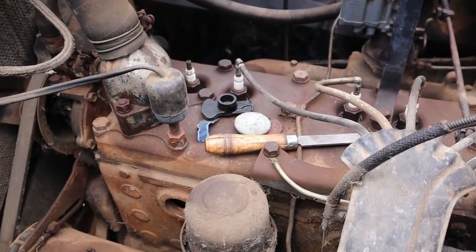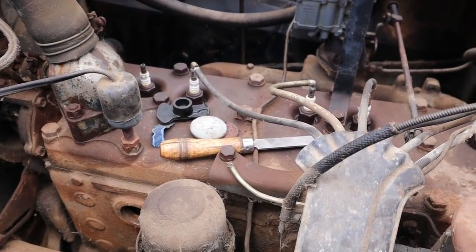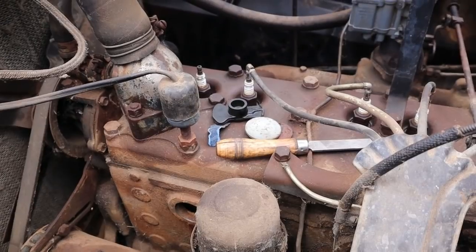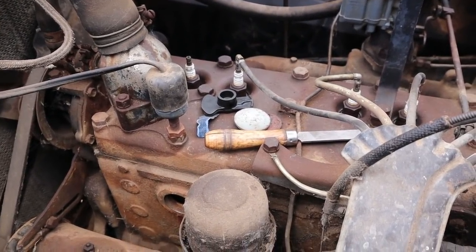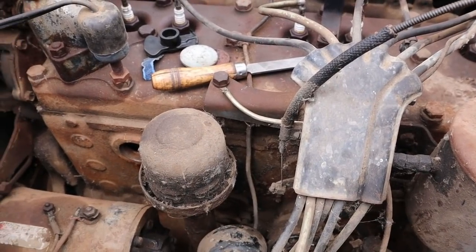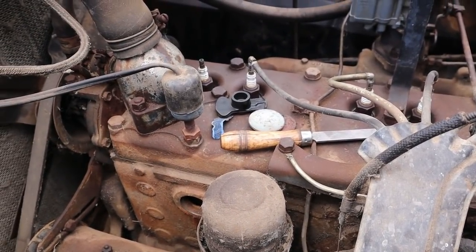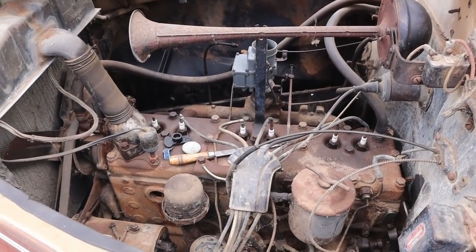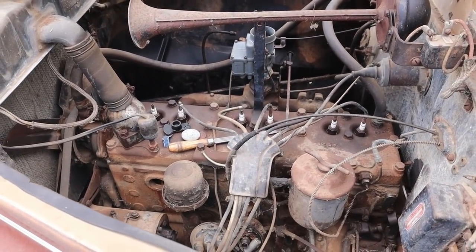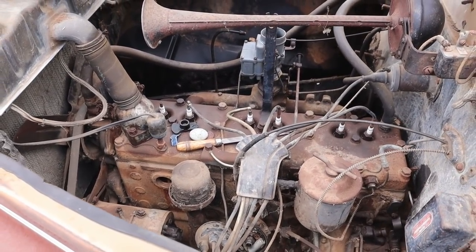As soon as I get the core plug sorted, we'll pull the plugs and have a look at those guys, and one wire is missing, which is kind of odd because they're not even very easy to take out, so an odd one to steal, but there we have it. And if we bypass all of the car's electrical system, then we're not going to do any harm by spinning it over faster with a 12-volt battery.